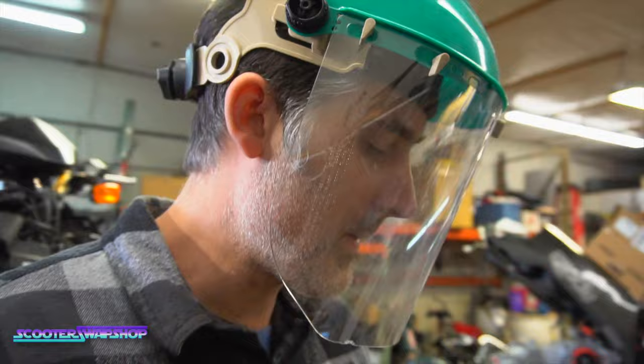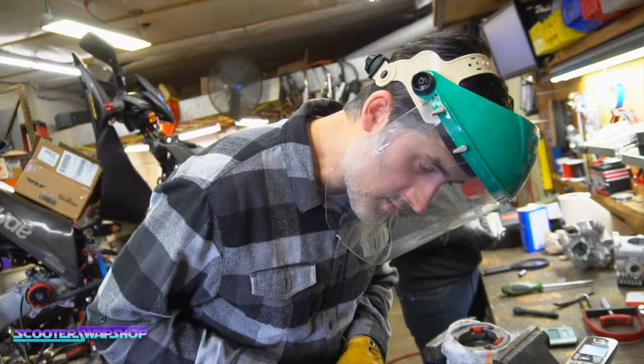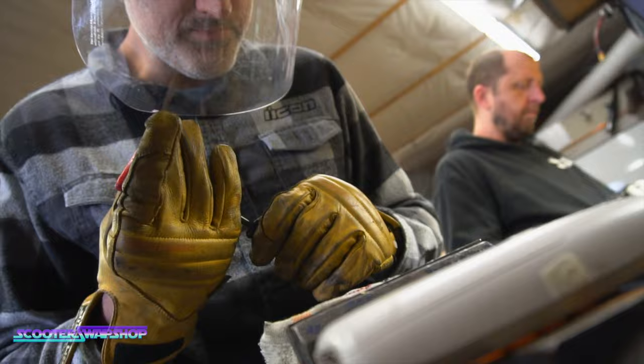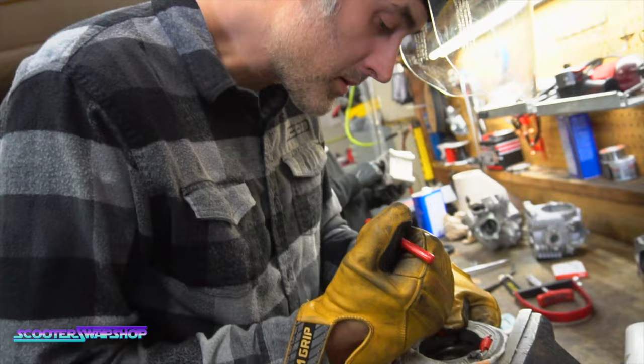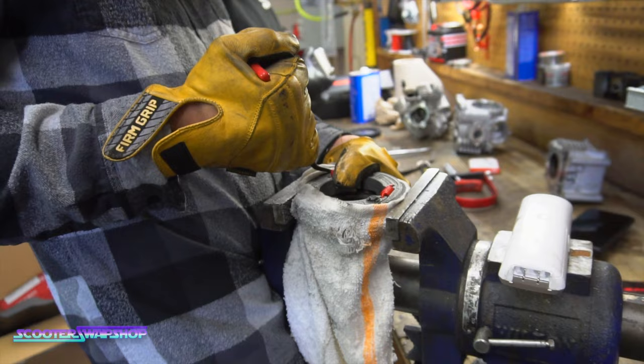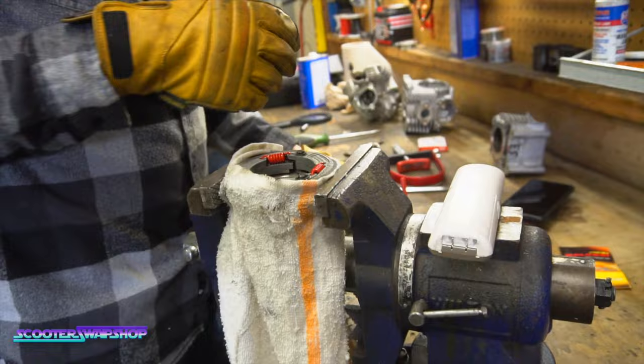Hey, man. Brian, how you doing today? I'm doing good. How are you doing? I'm not too bad. Look, I got my little UTV here. It's got a pretty sure it's a GY6 motor on it. I've been following some of your stuff you guys do. I'm online looking at a 171 CC big bore kit for it. Yep. I thought they said that you had to cut to go to 171 CC. You don't. You said it's a 150 CC right now, right? Yeah, it's a 150 CC. The hole in the case has 65.78. Yep, that'll bolt. The 171 kit will bolt right on.